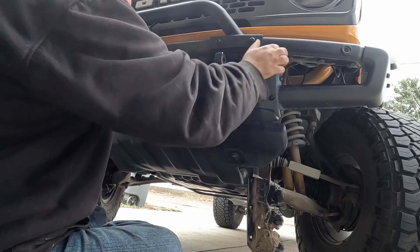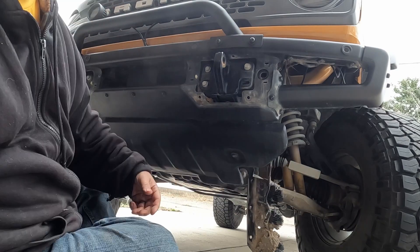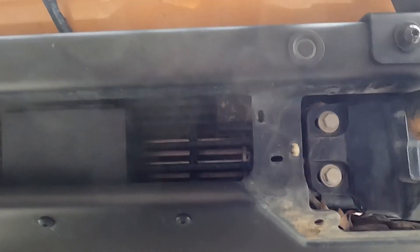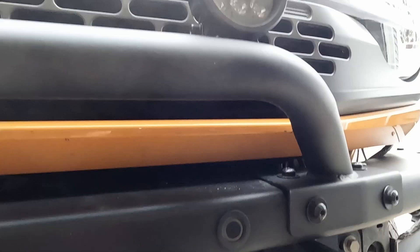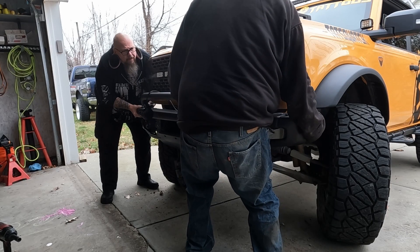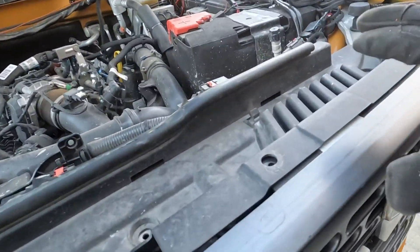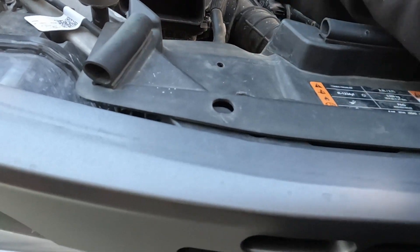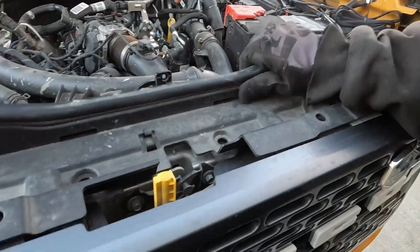Pull straight out. That exposes the three bolts on each side that are holding the bumper on. Once you take those off, the whole bumper will slide right off. Let's loosen up these lights up here so we're not yanking those off, and we should be good to go. So we got the bumper off. Then we're going to take the grill off next. To do that, first thing you have to do is take this piece out — there's a bunch of little pry tool clips that we already pried out. And you can just take this air box off; there's another pin that holds that in. Then we can just go ahead and remove this.